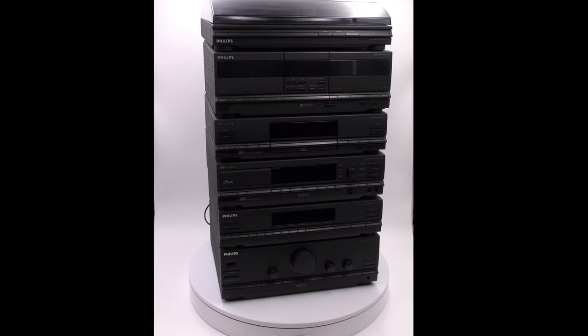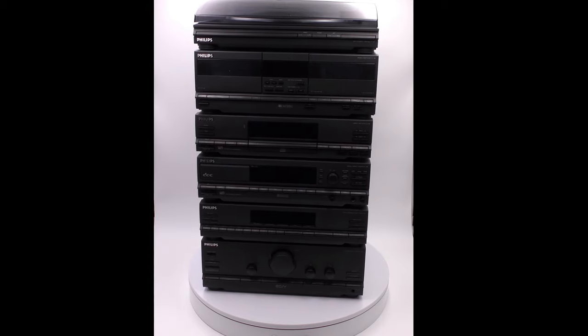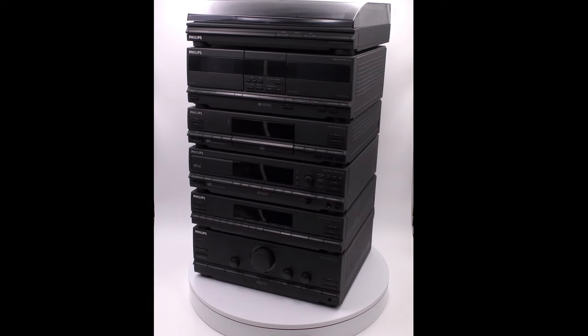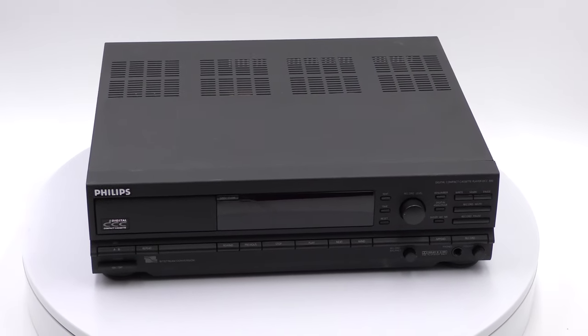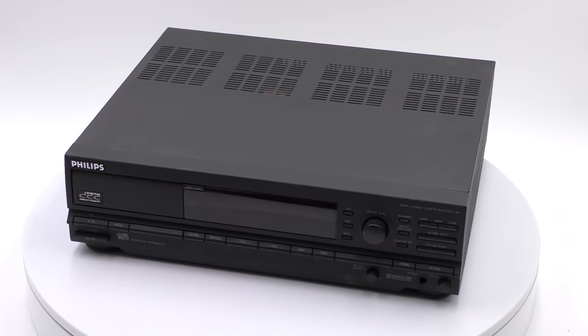The DCC 380 was part of a Philips set and used a system bus. The 380 was part of this original set, but often the DCC player version 380 will be offered for sale as a standalone. Most fans often wonder why their remote control is not working. If the 380 is part of the entire system it will receive its IR controls via the amplifier, but if used as a standalone, no remote will work.